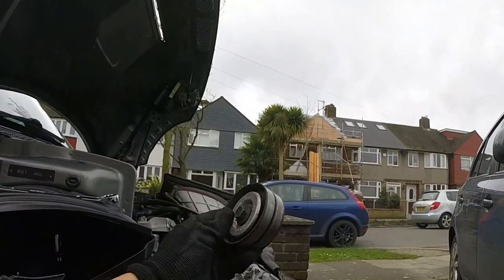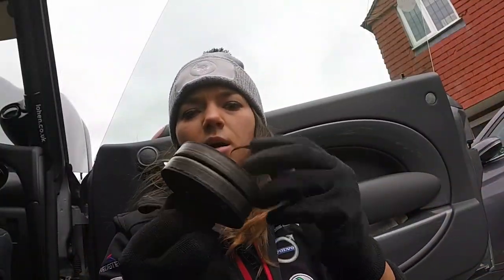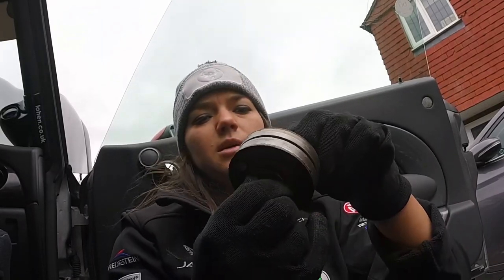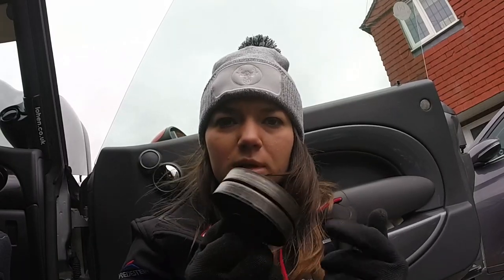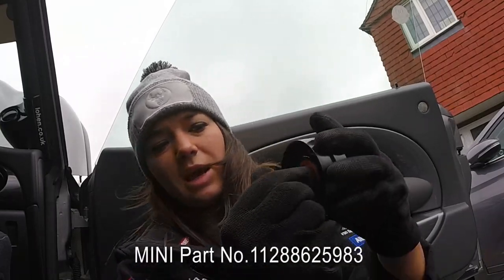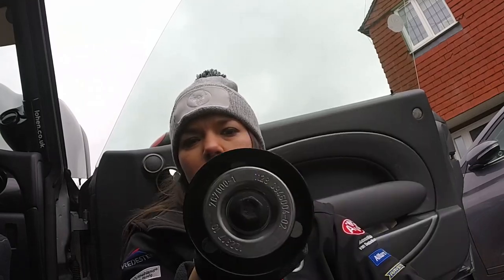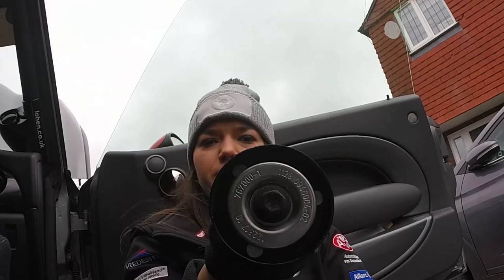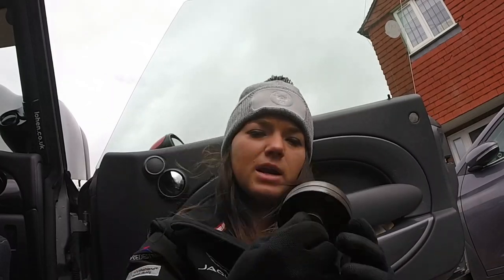Not bad — 80,000 miles in 17 years, I can't complain. I'm just going to compare it so you guys can see the difference. This is the idler pulley — you can also call it the stationary pulley, the idler pulley, the adjusting pulley, it's got a few names for it. You can see all the play in there — it's just totally come apart, and that's why it was whistling and rattling constantly, just a constant really tinny rattle. And this is the new one — see how that's fixed on, no play in that at all. If I give it a spin — job done. And if I spin the old one, it moves but there's just a lot of play in it and it's not sat correctly.